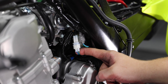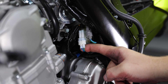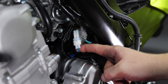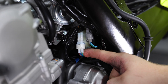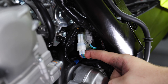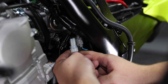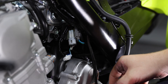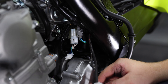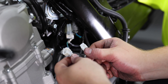Once you have your Power Commander routed, the first connector you're going to come to is your crank connector. It's going to be a white two-pin connector on the left side of the throttle body. Make sure when you're doing the install that you plug into the white connector and not the gray — we get a lot of phone calls at Dynojet from people plugging into the wrong connector. Once you have it unplugged, get your Power Commander harness and plug it directly in line with that connector.